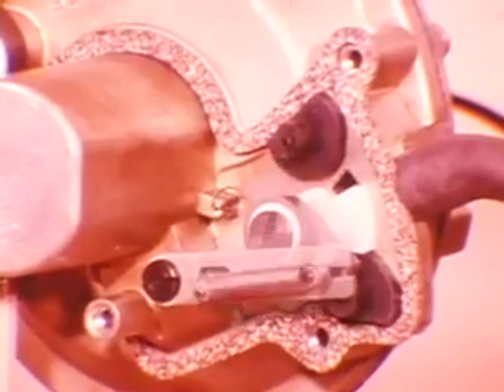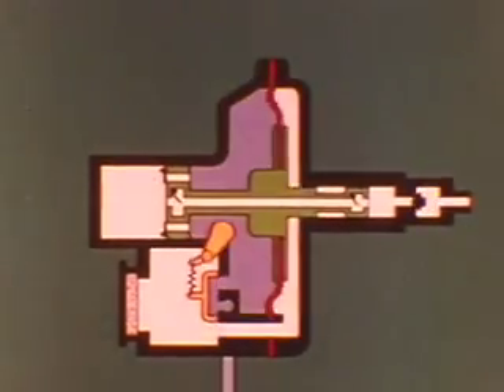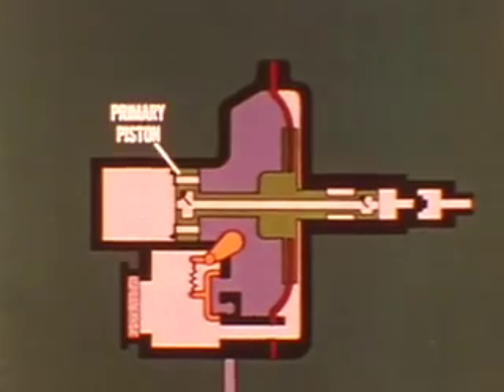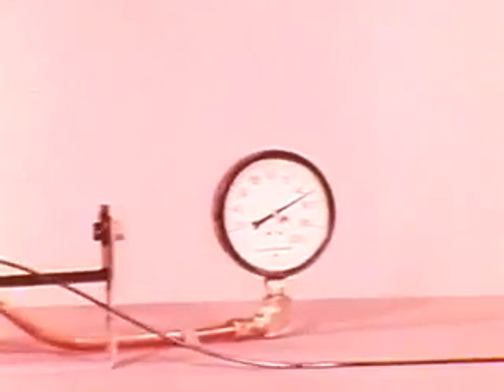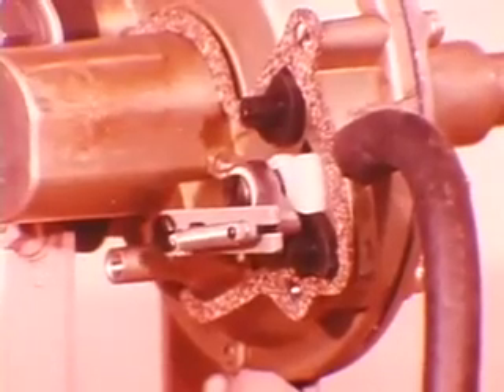This diverter valve simply opens and closes ports, which admit atmospheric pressure to one side of the diaphragm and vacuum to the opposite side. Diaphragm movement trips the diverter valve, which opens and closes a different set of ports. This reverses the application of vacuum and air on the diaphragm, causing the diaphragm to move in the opposite direction. The diaphragm is connected to a pair of pistons that produce a pulse of pressurized air sent through tubing to the reserve tank. A primary piston compresses the air first, then the secondary piston boosts it to a higher level. When pressure builds up in the reserve tank to about 150 to 190 pounds per square inch, normal engine intake manifold vacuum acting on the diaphragm is not powerful enough to overcome high pressure in the tank and tubing, and the compressor stops operating.